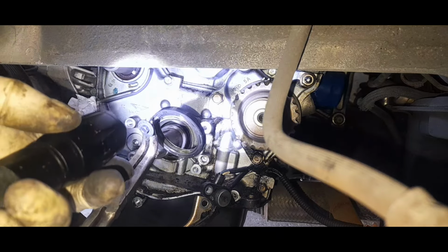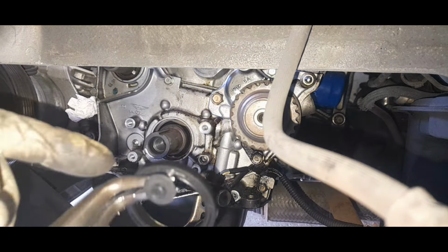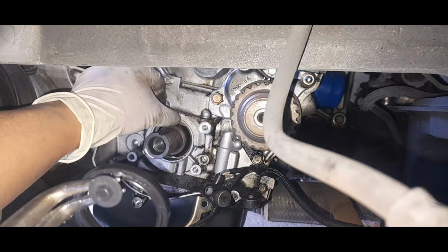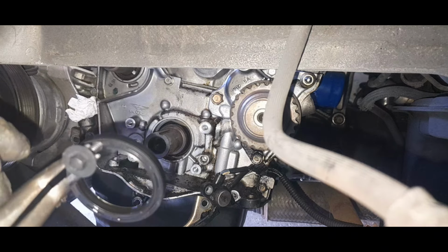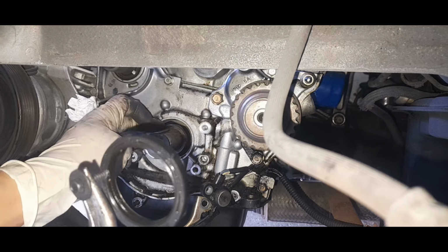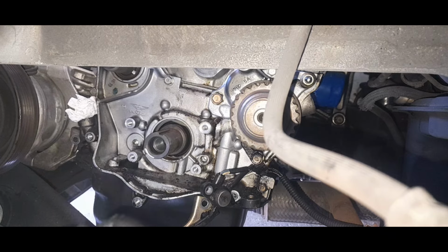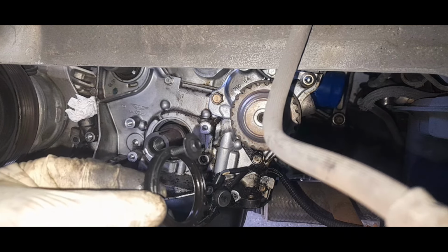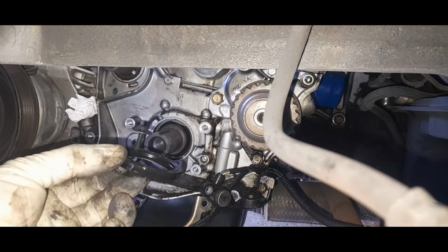So when I put the bolt, right, it's not on the side because it's gonna scratch the top of this oil pump. It's not all the way in too, that it's gonna scratch the crankshaft. That's really bad. So this is right dead in the middle. Right in the center. Yeah, so that's how you remove a crankshaft seal.